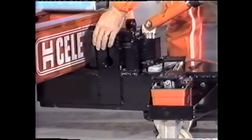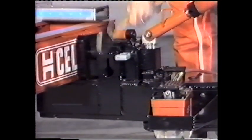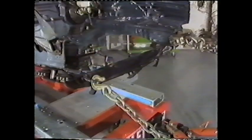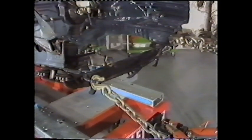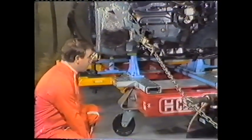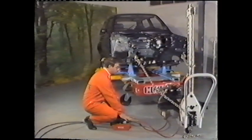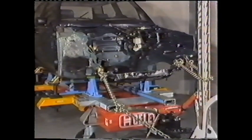The mobile Cayman pulling unit is easily anchored to the repair bench by means of one wedge. As many as five rams can be placed on the Cayman to perform multiple yet independent and simultaneous pulls on different areas of the vehicle. Two pulls move the vehicle forward, to the side, and down in one single operation.